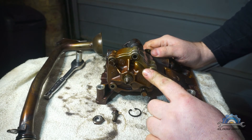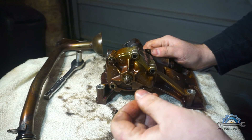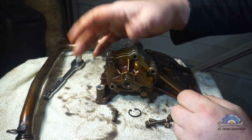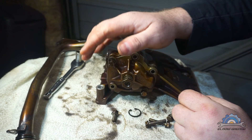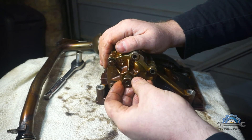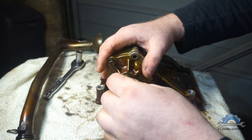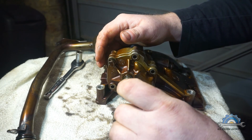In the front we have the housing with two rotors inside - I'll explain in a minute. I already removed the screws. The nut I've explained before, however I didn't open the pump so I'll explain it again. There are cases on forums where this nut might become loose and fall off, the sprocket drops with the chain, you have no drive, the pump stops turning, there's no oil pressure - disaster.